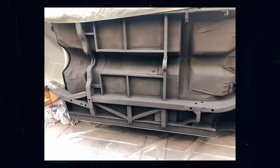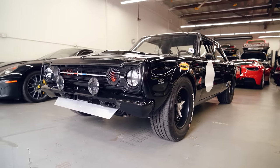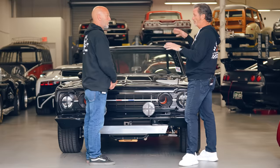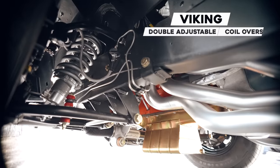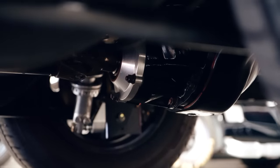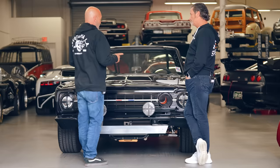The frame is completely caged — it's a 12-point racing cage, all boxed in with lots of underpinning, so the frame is really stiff. Staying with torsion and leaf suspension would have made this car not fun to drive, so we went with Viking twin-adjustable coilovers, a new K-member, and a new four-link. It gives the performance and rigidity of the frame with the drivability you want.